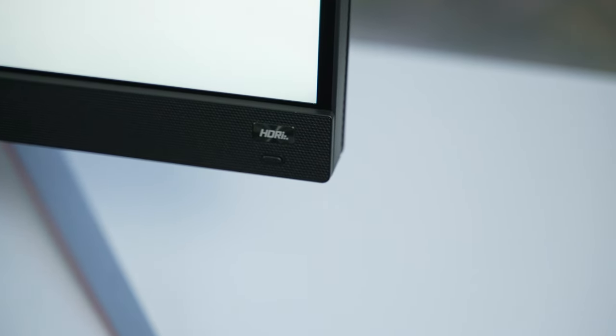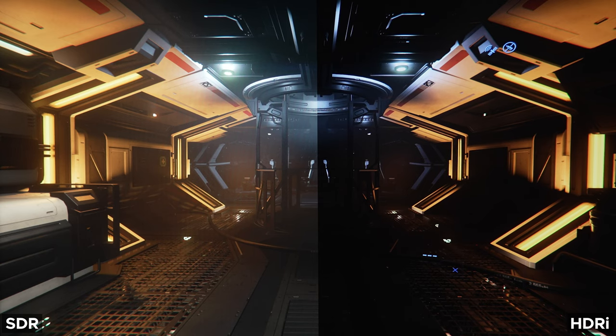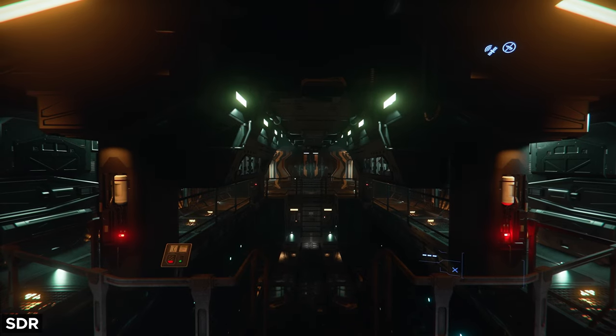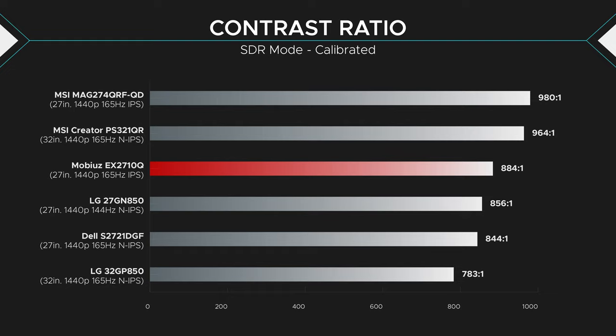Another feature that I don't like as much is called HDRI, or HDR intelligence. I know BenQ is not going to like me saying this, but honestly I just think it sucks. It's basically an artificial intelligence HDR that detects what's happening in the scene and automatically adjusts the HDR effect. It's pretty bad because this monitor doesn't have any actual backlight tech to give you a real HDR experience. Some people might like it, but anybody who's experienced actual HDR is going to think this is terrible. And the contrast ratio chart kind of agrees — with no special backlight tech like mini LED or OLED, you're just not going to get the best of the best.